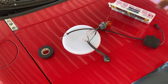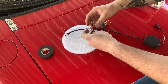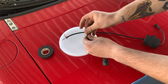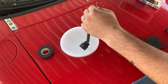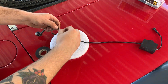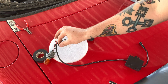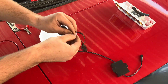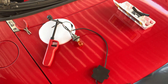Since I'm not using a soldering gun I have to at least be somewhat professional here, so I'm going to be using shrink tube on this when it's done. This can just slide down there right now. Trust me, I know this looks bad — this is not the way to do it. This piece of shrink tube was a little bit too small but we're going to make it work — slowly slide it across. It's now time to do the exact same to the power side, and now I'm going to apply electrical tape around all these connections.